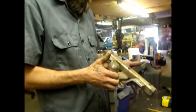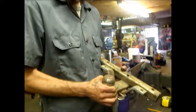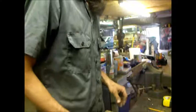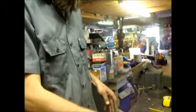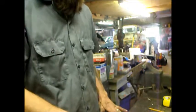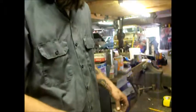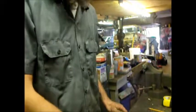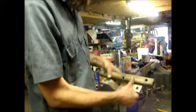That means we need to tow them, and we're going to use the Cadillac because we'll be able to tow with that 472 cubic inches. So I have this old hitch — it came off of a Delta 88, then it was modified and cut off and put on the back of our trailer. What I'm going to do to modify it to fit the Caddy: there's one hole in the center of the bumper at the back and there's really no edge for this to bolt to. I don't want to weld anything to the bumper and ruin the chrome. So I'm going to make a fillet piece, weld it here and here and here, put one hole in it to bolt right there at the back, and then there's a crossmember I'm going to bolt this to. I'm going to add some back to it, sleeve it, weld some on there, cut this plate, put it in there, and tie this into the frame somewhere to give it a little more strength.